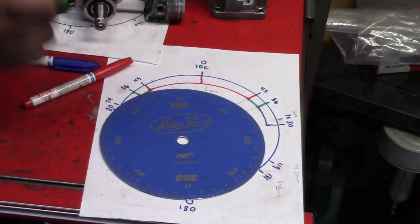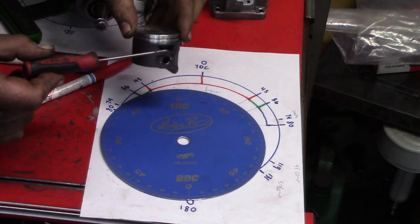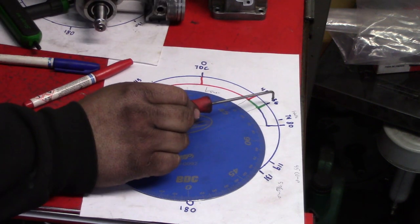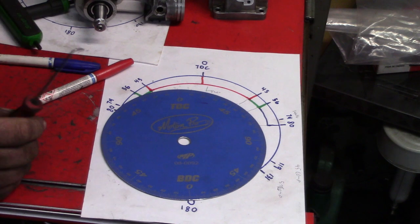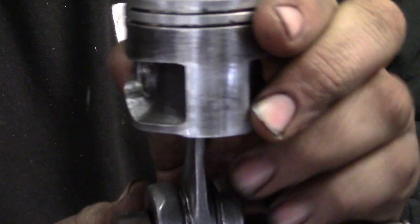See how this looks? Red mark is here. This green line is that little bridge. And here to here is this upper window — the upper strato window. In between 56 and 80 degrees, what happens after top dead center? Your intake opens. Now at top dead center, this is open to your intake all the way, and as this is coming down, there's going to be spit back — I'll explain.